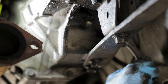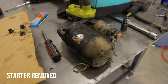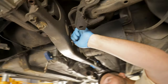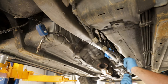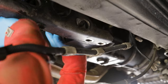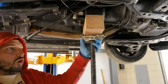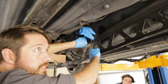From here on out there's a voiceover narration because this was a lot to do in one day with limited time at the shop and some things were hard to film. You can see we got the starter out, removed the exhaust and driveshaft since we need all that out of the way to drop the transmission. Here we're undoing some wiring on the PPF since we need to drop that as well, and pulling the bolts out of the front of the PPF that go up into the transmission. We're using a screw jack on the lift to support the transmission as we loosen everything.